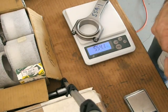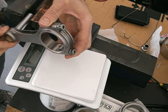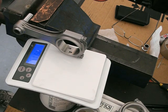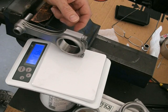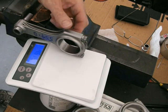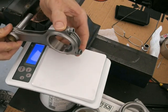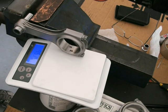To balance them up, after measuring the big end weight — which is what I'm doing here — this is not 100% accurate because a lot of factors could influence this, so it's a bit crude. It's just the gudgeon pin in a vise, with the scale set up so the rod is horizontal when weighed. There's a bit of friction, lubrication differences — a lot of things that can affect this. But these were very consistent.